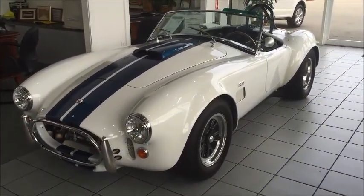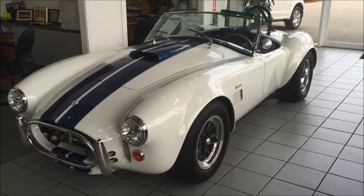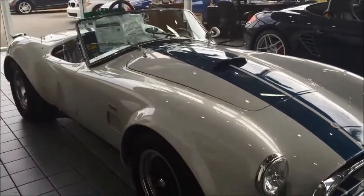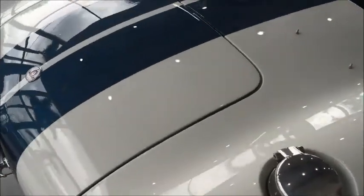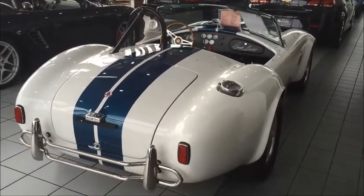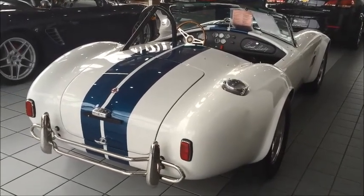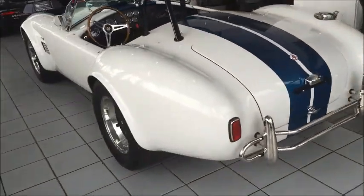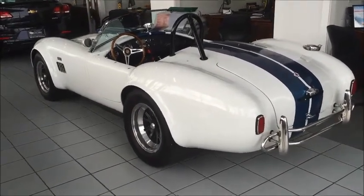The ERA has a much more rigid design as far as the frame and chassis go. It's a tubular frame design and the body was actually adhered to the frame using the same technology that Chevrolet uses on their late-model Corvette — a composite epoxy material to attach the body to the frame — which provides much better body rigidity, lower noise, and the bodies are actually completely insulated with sound deadener and heat insulation.